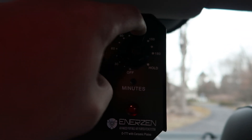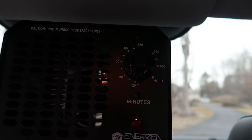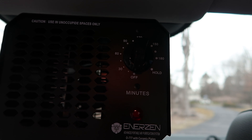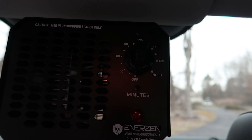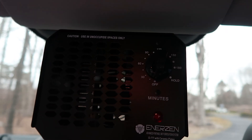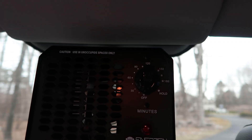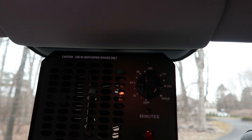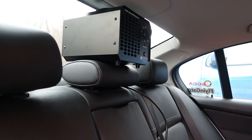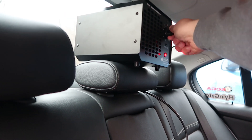If you're really concerned you can put it up to 120, 150, or 180 minutes. The more time you put, the more ozone it generates and the more organic material it gets rid of. In my opinion, anywhere between 30 and 60 minutes is more than enough. I'm going to set it to 60. As soon as you hit that dial it will turn on, so what you want to do is stand slightly outside the car, hold your breath, set the time, and close the door. You're going to hear me hold my breath, set the time, close the door, and then breathe again — just an extra precaution.